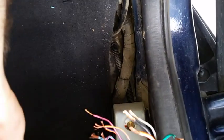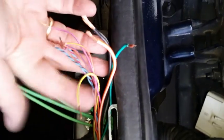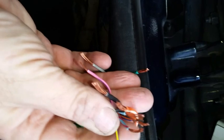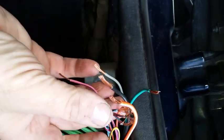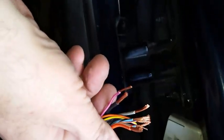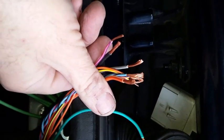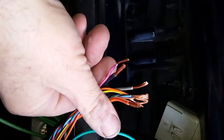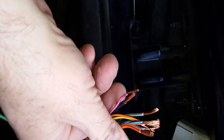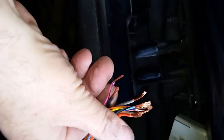And the idea is once it's all put together, this wire is much heavier duty, 12 gauge every connector, and it looks like it's going to take flexing a lot better than the original. Because the passenger side wasn't used as much as the driver by far, none of these wires I could strip right at the ends where they had been cut from the connector. All this length leading up to these stripped ends is in really good shape. So the passenger side really didn't need to be repaired at all. But since I've done all the other doors except this one, I had the part to do it. I might as well do it. That way, by the time the Jeep goes to the yard, these doors won't be a problem at least. So that's how that looks.